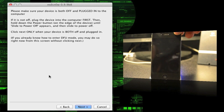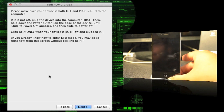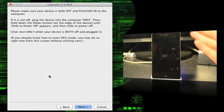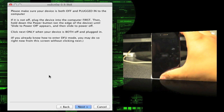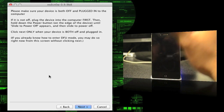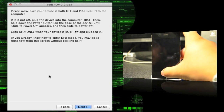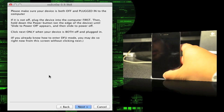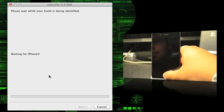As you see on screen, it's telling you to plug in your phone and make sure it's turned off. Now we need to do that DFU process again: hold down the power button for three seconds, then hold the home button and power button for ten seconds, then let go of the power button while still holding the home button for about eight seconds. Let's start: one, two, three — now for ten seconds.